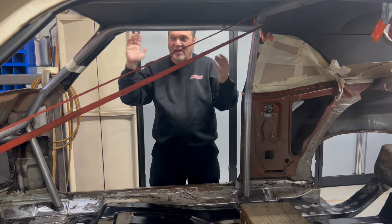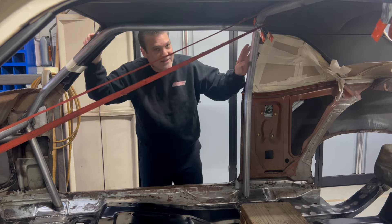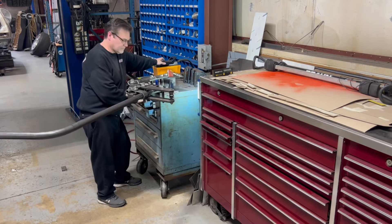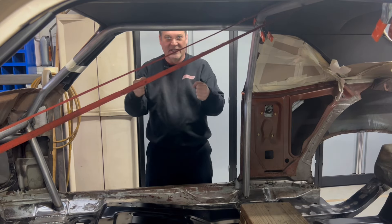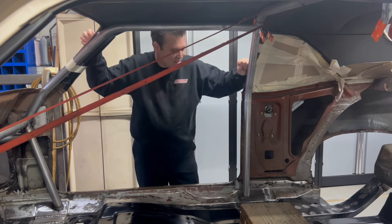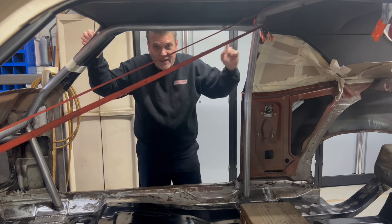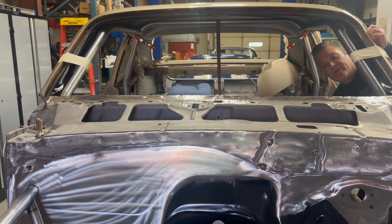I'm going to take you to the front of the car to show you how symmetrical the bars are and how tight they are to the pillars. The main hoop is really tight too — I showed you how I bent the main hoop, and I've built so many of these cars that I can bend all these bars without even having the body here. This is pretty critical — in any race car you want this tight to the roof and tight to the outside. When you're sitting in the driver's seat staging or driving the car, you're totally comfortable, your arm isn't hitting the roll cage. And if there was ever an unfortunate incident where you rolled the car, this thing needs to be up above your head — you definitely don't want the roll cage even with your helmet or below it.